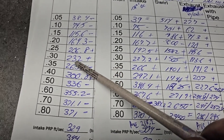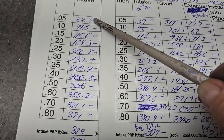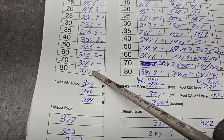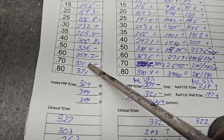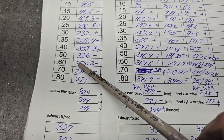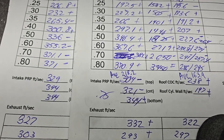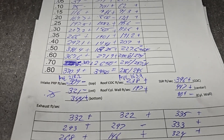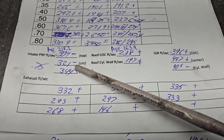We're still quite good — 232 at 300, actually better at 300. A little bit of loss in the mid-range; I couldn't care less. It didn't quite top out as well as the other one, but point one I can live with. We can look at the air speeds and maybe find something different. The only thing that comes to mind is it may be the other head, in which case it looks pretty good because we definitely have some discrepancies in our air speeds.